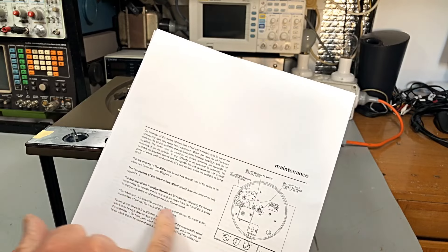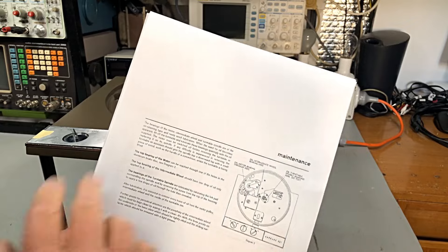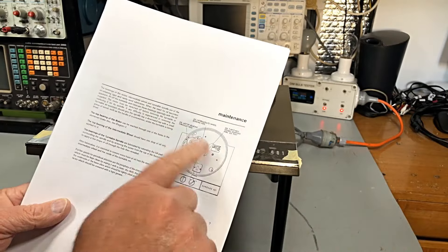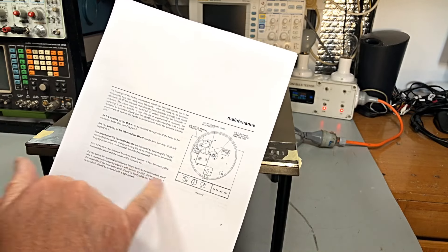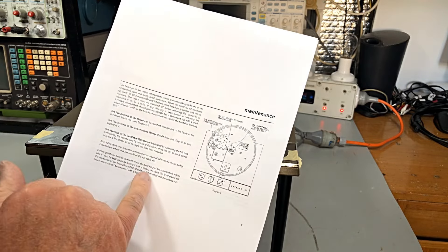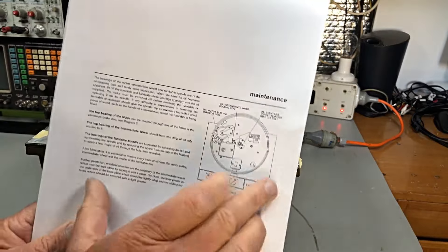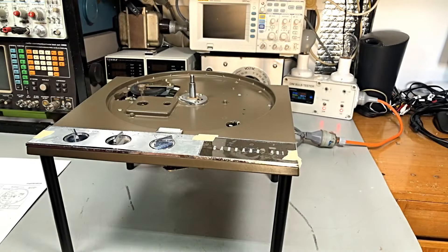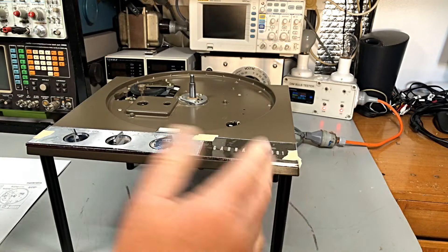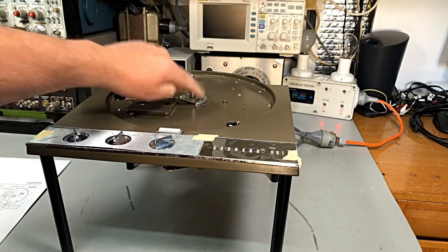After lubrication, it's essential to remove every trace of oil from the motor pulley, intermediate wheel, and inside the turntable rim - we haven't scattered oil around there, so we don't have to worry about that. For periodical maintenance: the lever points underneath need some light grease, light oil on sliding faces. We've done the underneath of the turntable. The only remaining maintenance task will be to remove the screw, put about four drops of Singer sewing machine oil in the hole, put the screw back in, and make sure there's no oil around.